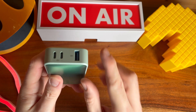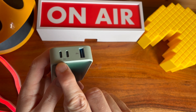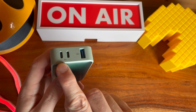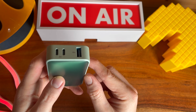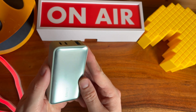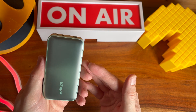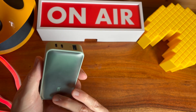Out of the USB-C ports we have a total of 30 watts. If you plug one USB-C cable in you can charge something at 30 watts; if you have two plugged in you can charge up to 30 watts combined. This means you can actually charge laptops with this battery pack — I can charge my MacBook, other laptops, and DJI drones.